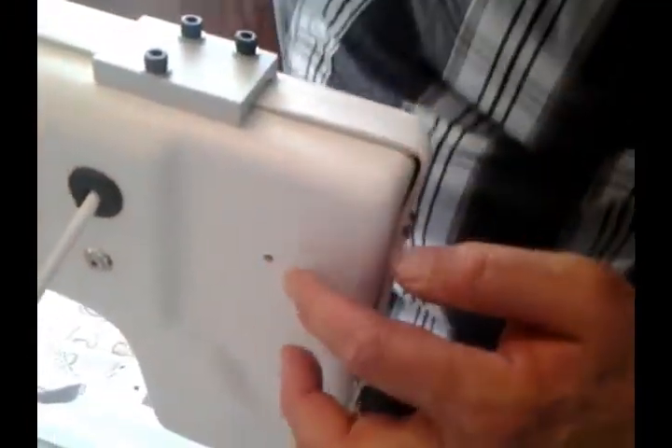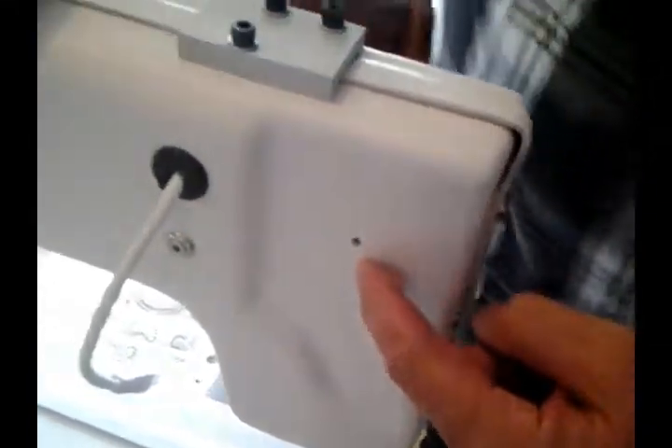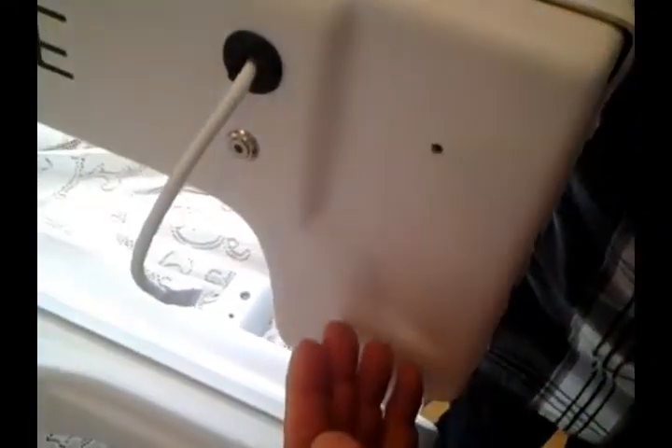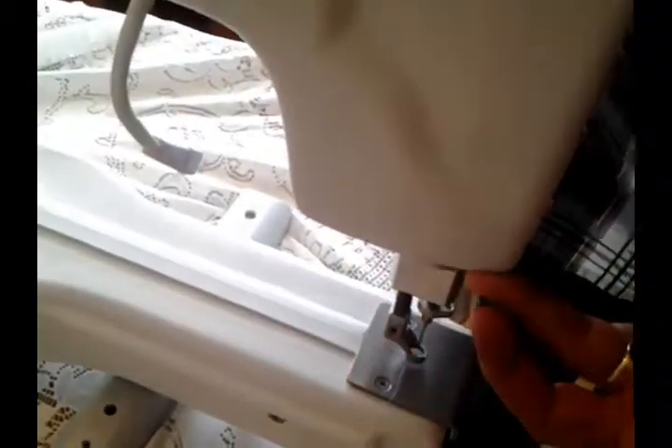You'll feel a piece of felt, and then you put one drop in there. It's important that you put the oil into the felt washer located right inside here. If you miss the washer, the oil will just run down the inside of your machine and come out down here. So each day before you quilt, run your finger right here and look at it to see if there's a lot of oil.